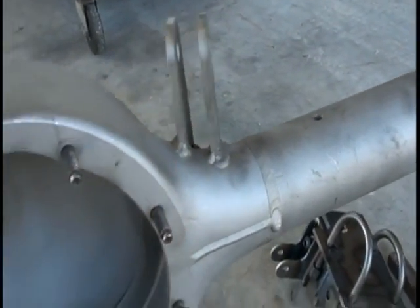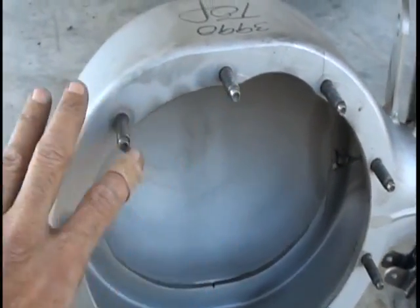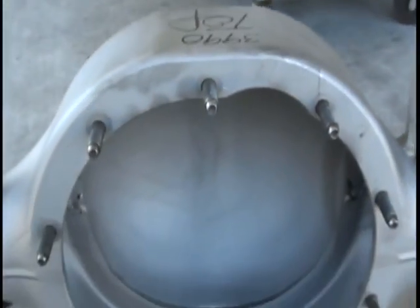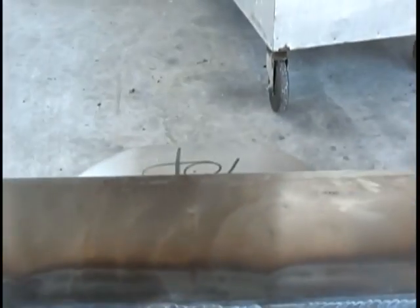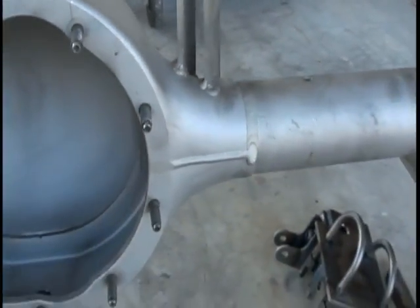If you're using your existing 8-inch or 9-inch housing, you would just remove your housing out from under the car. You still have your center section in it, of course. You would not have these brackets on it. All you would need is for us to send this bolt-on bracket. These particular ears here, you would take the top 3 bolts off of your carrier. This would bolt over the nuts. You put the nuts back on. Your gear would be sticking out here, of course. It would still have the gear in it. It just makes this a bolt on. That came welded on. We weld them on when we can, but you can put them on. And of course these things on the end, I've just got built up on stands to hold it.